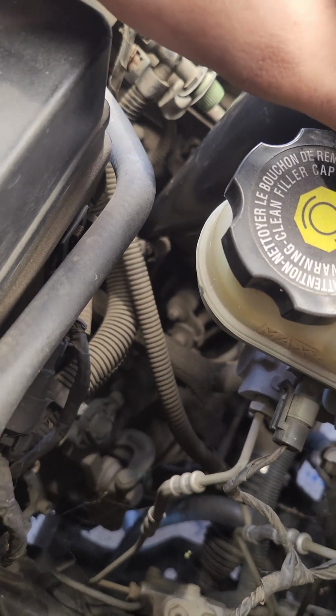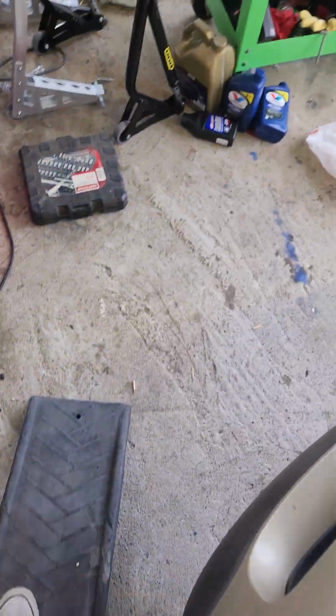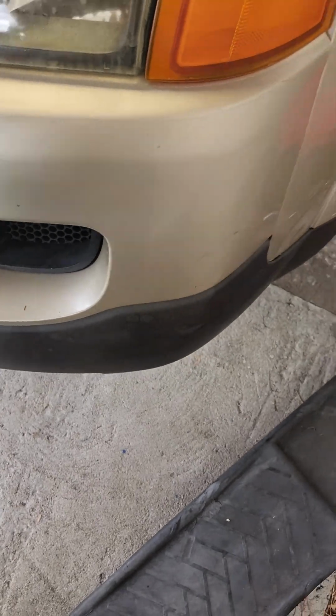You can see right there, it looks like the funnel is in place. Kind of barely. Gonna make sure it's like that. Just take it slow. Look, it's in there, got the light ready to go. And that fill plug, like I said, is gonna stay open because that's gonna be our fill indicator, because you want it to be barely pouring out.